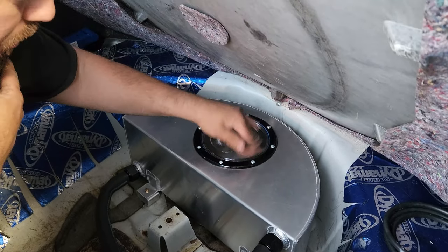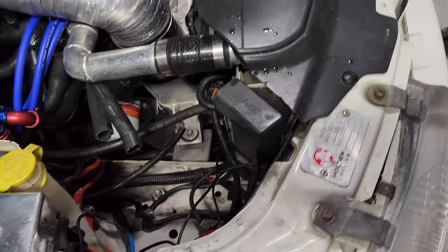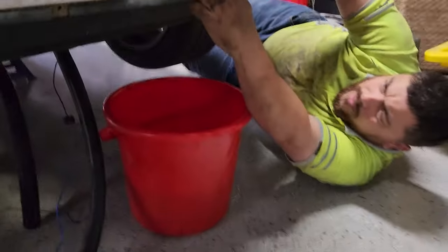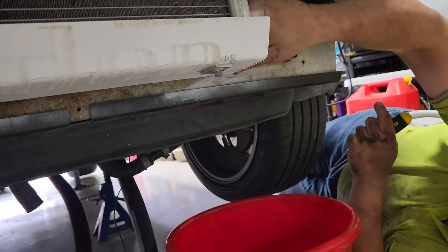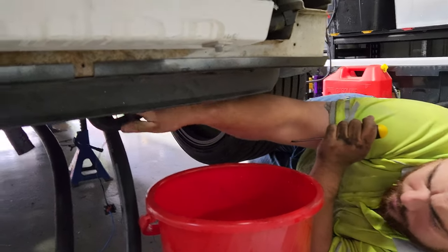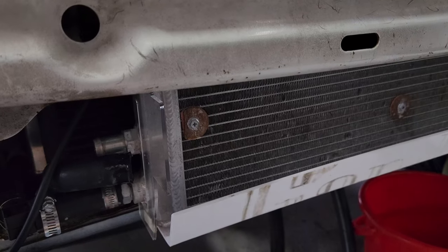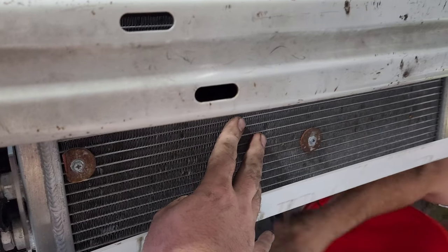That's where Ev keeps his stash - in the ice tank. So where we're at the moment: we've taken out the old water reservoir, that's all gone, lines were cleaned up. Old hoses here, so that's going to come around and go down. Sean's here undoing some hoses at the front. We're trying to re-jig all the lines to make it simpler and neater. From before we had hot water coming in from the top, down around triple pass and coming out the bottom. We're now changing it to come in from the bottom - the reason is that part of the cooler spends more time in the cold air.